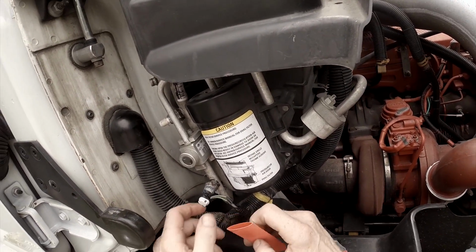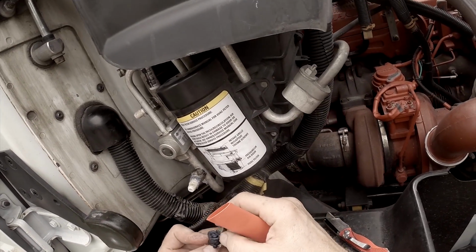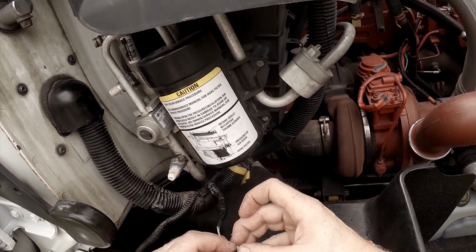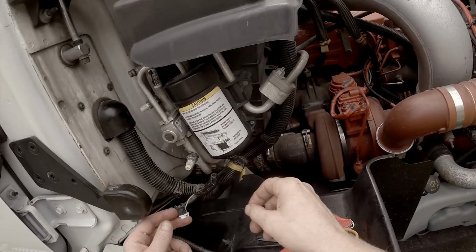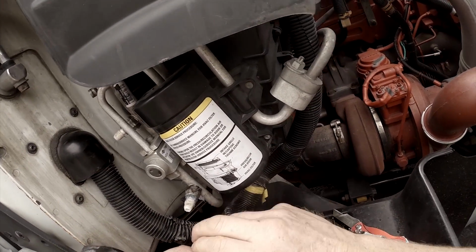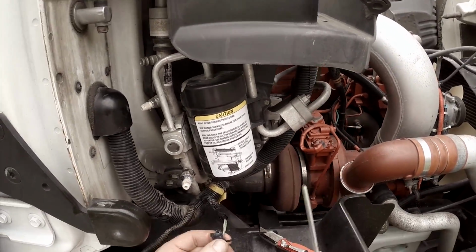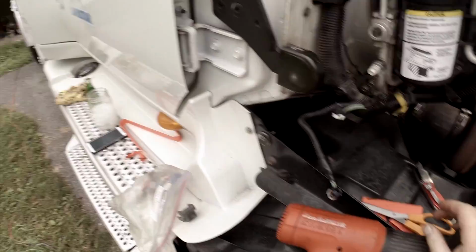So I put new thermistors in here. Now what I'm doing is trying to protect them. I'm going to try and make them moisture proof and see how this works out. But what I've done here is just a little extra with the zip tie, just to try and help those wires stay in place. On this one I've already gone and messed up. Now I've soldered them pins in there and everything, but I don't see where this will hurt anything. Now, like I said, I soldered the pins to the wire, which is definitely something you want to do on a workbench if you can, as opposed to trying to do it in a truck stop parking lot or whatever.